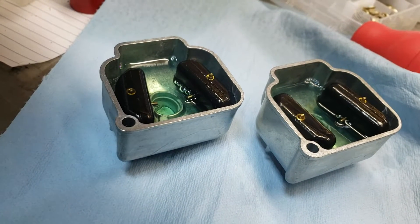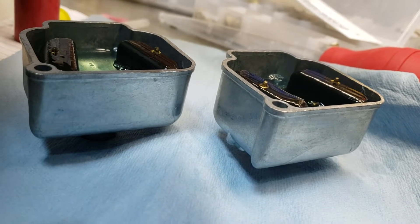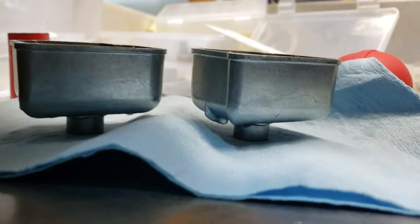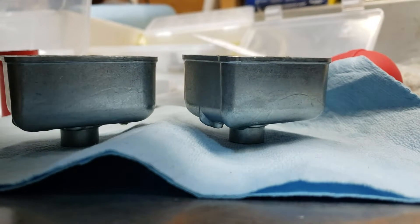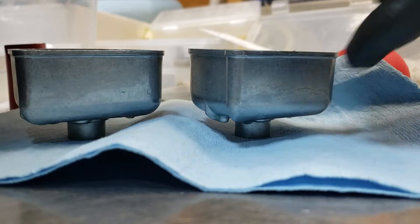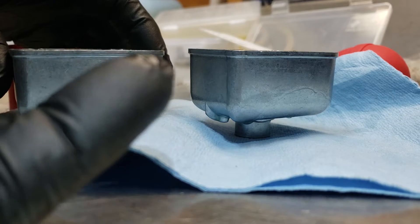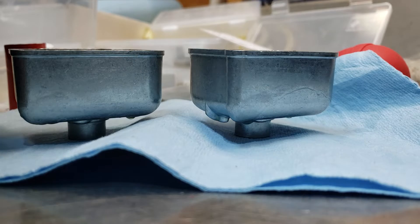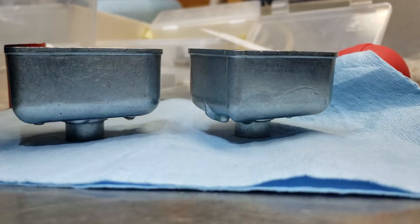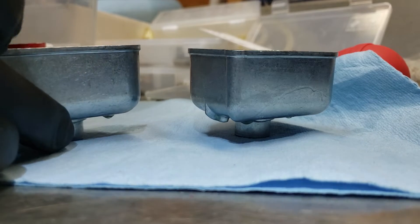What I've got here are these carburetor bowls, and it's kind of new to me, but they are sweating fuel out the sides of them — out the side towards the engine. I've never seen one do this before. I'm going to prop the phone up so you can see what I'm seeing. The front edge right in here — you can see a kind of a wet spot. If I take my dry finger and wipe it, I get fuel.